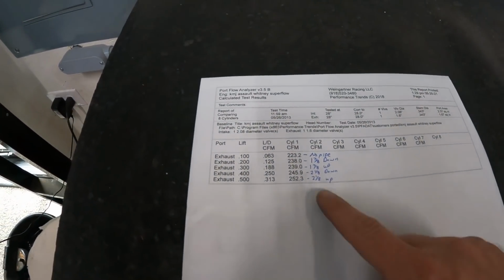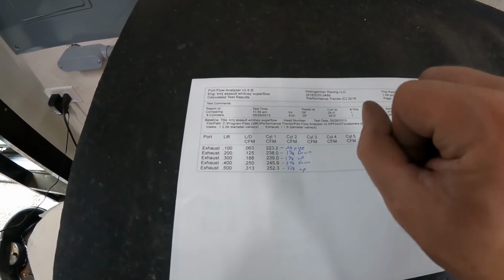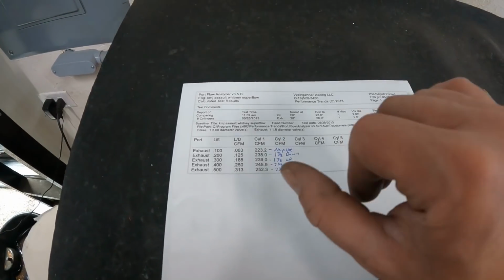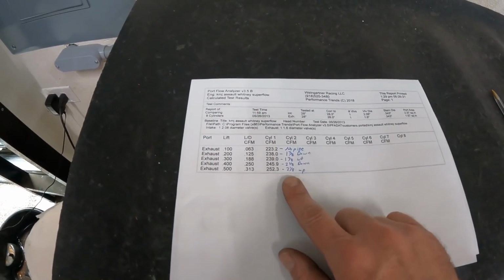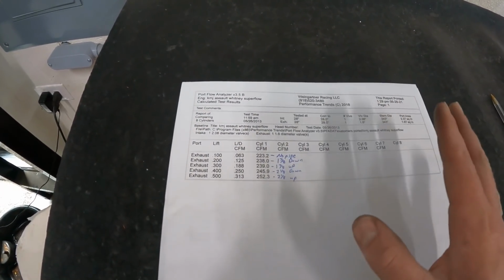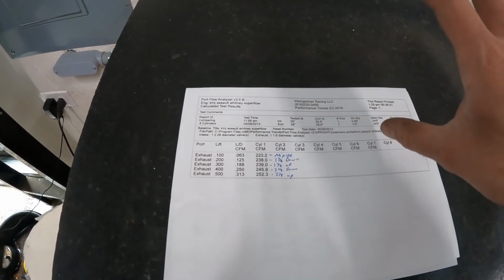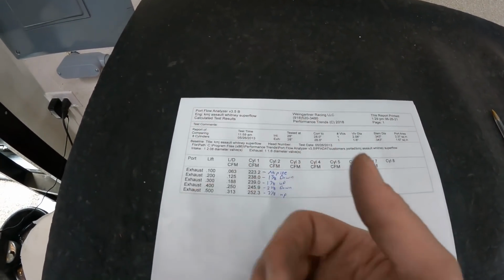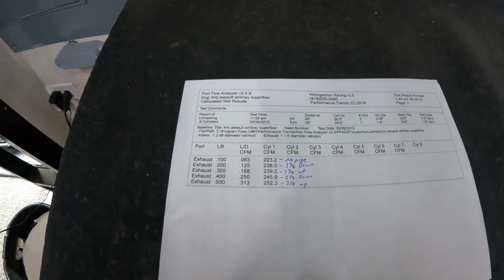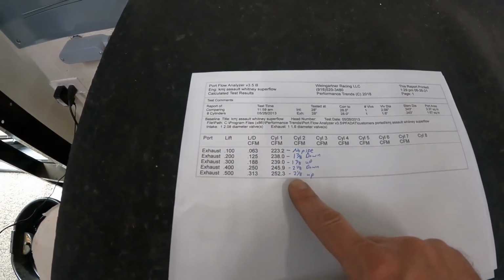Anyway, if you put a big exhaust pipe, you have very little airspeed leaving because it just drops out. So you have no real pressure drop happening because you don't really have a high pressure area or low pressure, because it's diffusing all that pressure pretty much with a larger pipe. I'm oversimplifying, but hopefully you can get the idea. Point being is, if it has such a big area it expands to, you're not seeing a high pressure area, which means it can't create a low pressure area behind it for it to draw in more air from the intake valve during overlap.